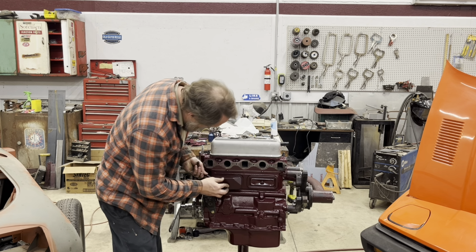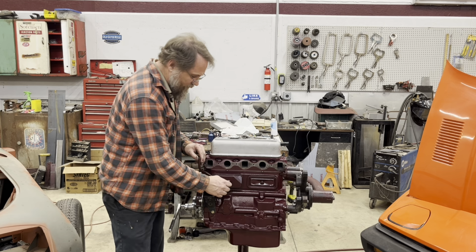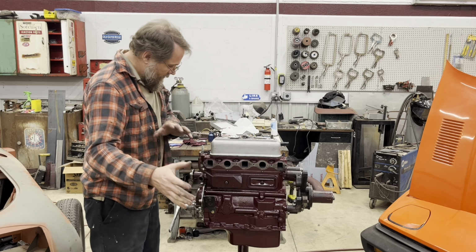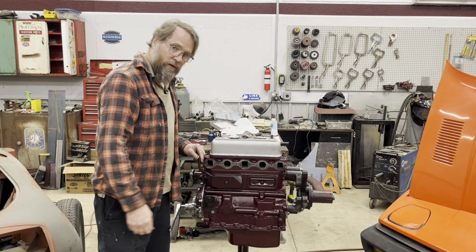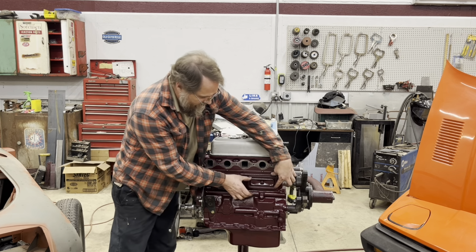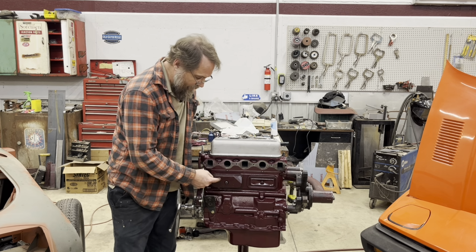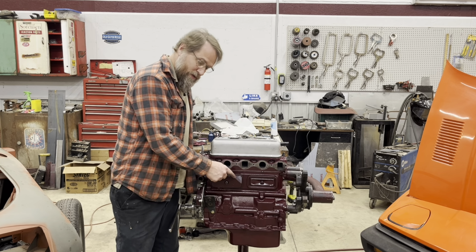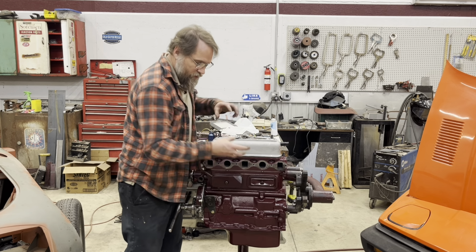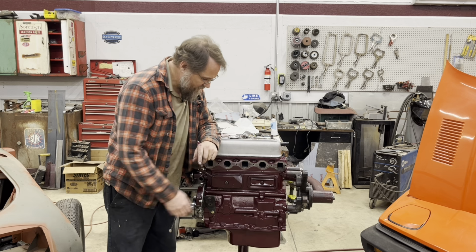with just a little bit of pressure on it to make sure that the gasket sealer dries up and is stuck there good. Then I'll take it off, do a little bit of oil around it, put it back on, and then tighten it down. And the number one cause of these leaking is either misalignment, because they're not quite straight, leaving a corner open, which is really easy to have happen on this front side cover with the rubber seal, but also over tightening them. You over tighten them, you change the shape of them, and then they never seal. So probably over tightening is the number one cause of these leaking.